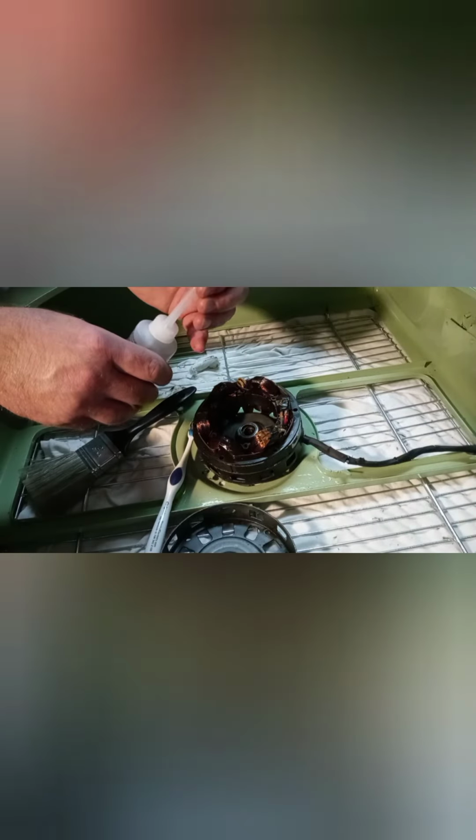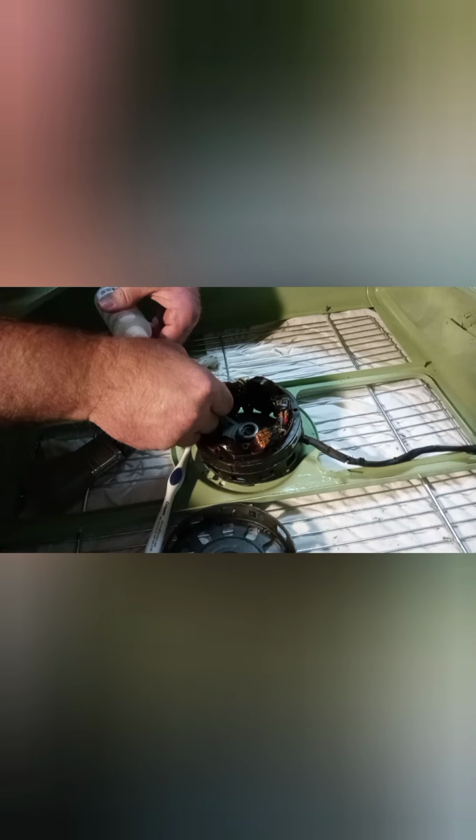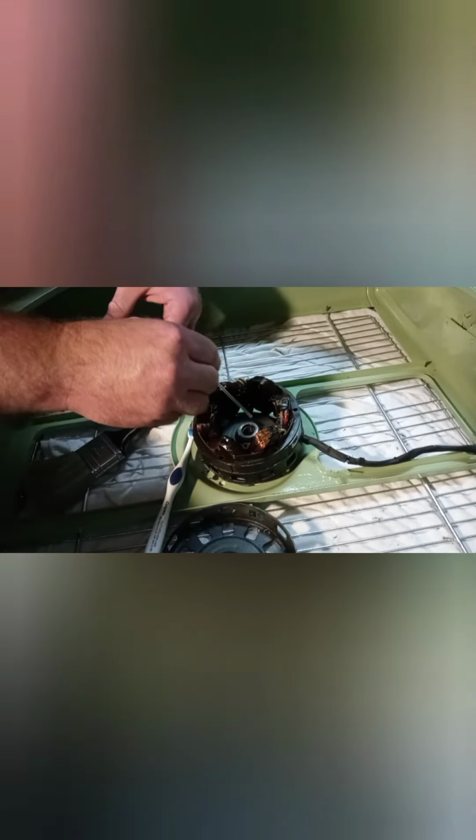It also has the tube that you pull out to make it easier to oil everything. So let's go ahead and remove the tip here. Take that off, put it to the side. Put it to where you can see everything. Want to get it in between the bearing there. Go all the way around, very carefully, not to get anything on the windings or inside the motor where it doesn't need to be. And if necessary, just apply a few drops there into the bottom of the bearing.